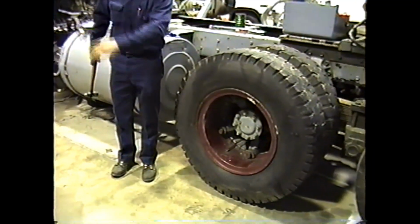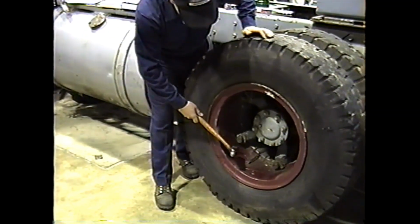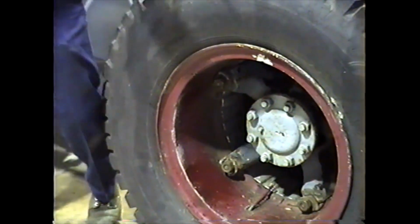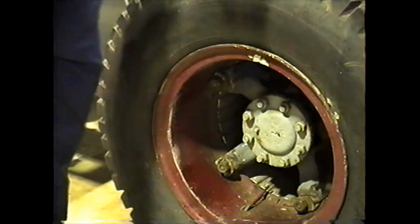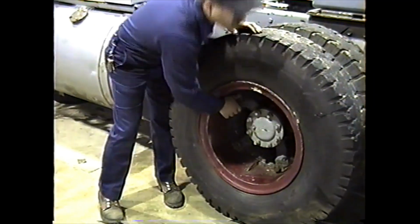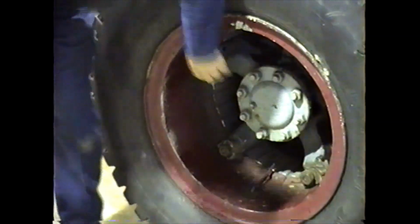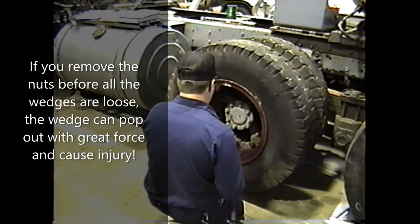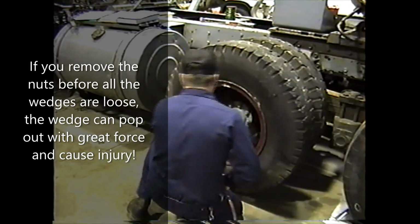So you guys are standing directly in front of this. You want to move to the side. And then you take a hammer and just pick one wedge and strike it. You hear that bounce? That means the wedge is breaking loose. And before you take the nuts off, just make sure all the wedges are loose. I still have one tight one, so go back and strike that one. Now that one's loose. You guys can follow me on the handout then.